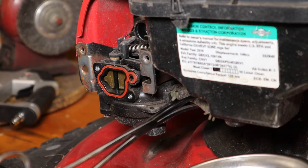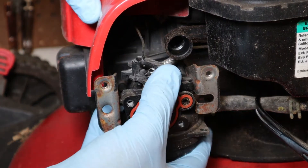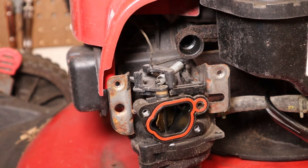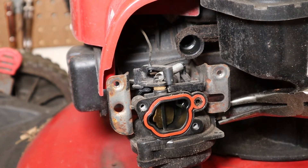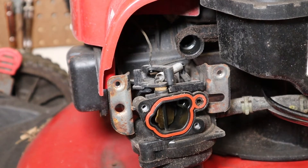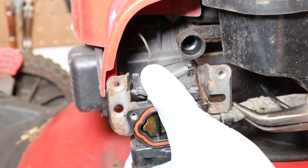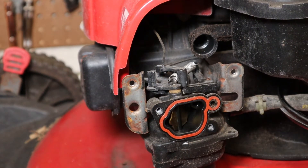What happens with these is there's a jet on the bottom that likes to get clogged up with stuff. Let me get you guys re-situated so you can get a better view of the carburetor, which is right here. It just slides out, but you kind of have to disconnect the fuel line and a couple other things all at the same time. Let's disconnect the clamp that holds the line on, then slide the line off carefully. Remember this is all plastic, so you don't want to break anything. Maybe have a little something ready to go because there is fuel there.